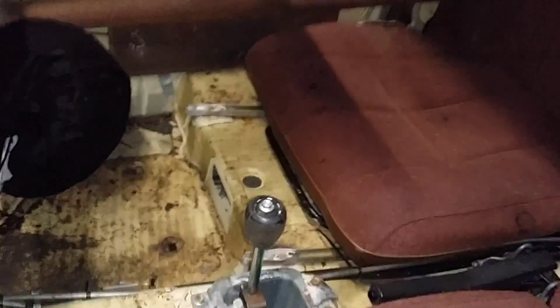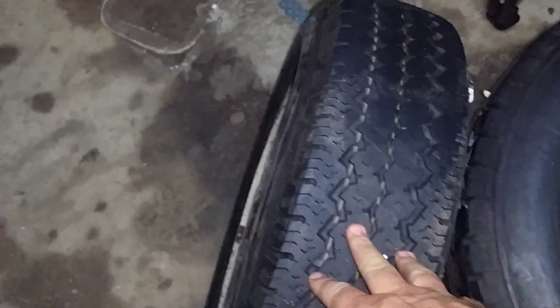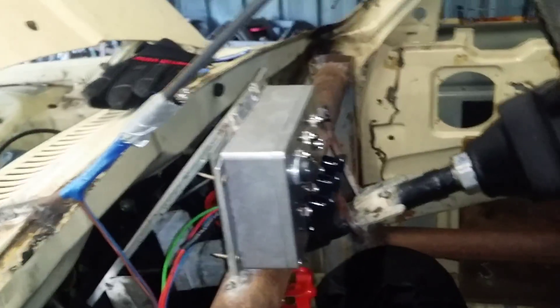I still had to finish cutting the rails off the seat and make a cover for the fuel filter — I think that's about it, there was very little left to do. I've finally got the tyres done — they now have light truck tyres on them, six-ply sidewalls, eight-ply tread. I was going to cut grooves in them with an angle grinder to give more grip, but not necessary though it'd be helpful. It comes with the fuel tank — the tank itself is $50, pump's another $50, there's $50 worth of cabling and wiring in there, and those Anderson plugs are $20-25 bucks each.